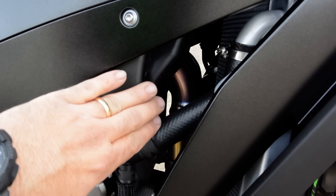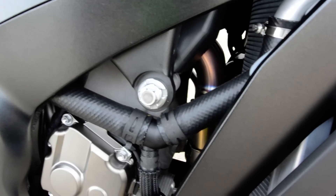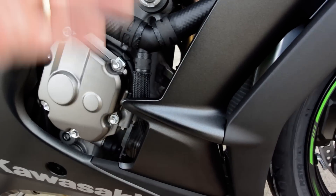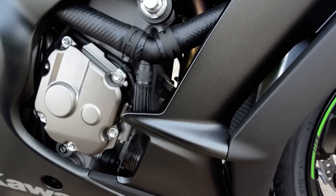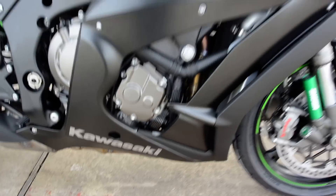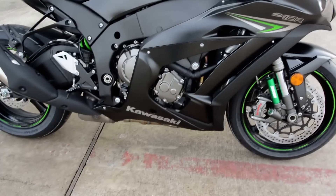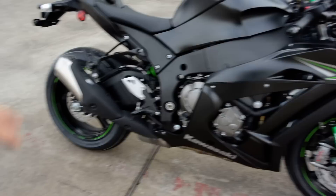The titanium alloy actually has better heat resistance, which lets them make these thinner and lighter. These headers are very similar in length, shape, and size to the race-spec headers — titanium alloy, very close to race spec. Kawasaki designed it so that you'd leave that header on, and maybe if you're racing, just add a race slip-on, and you'd be done as far as exhaust is concerned.